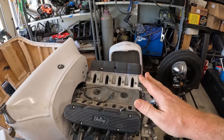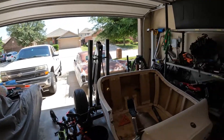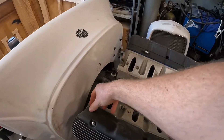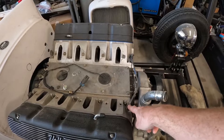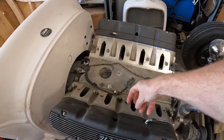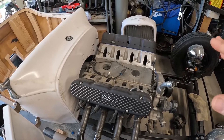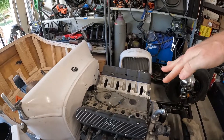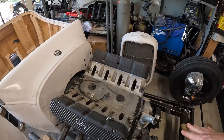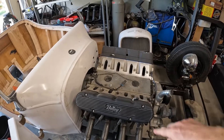Let me explain. In my truck there, from the factory, the front of the engine is higher than the rear of the engine. That allows any steam to flow up and out of these steam ports. If the engine's the other way, obviously that air pocket's going to make its way to the back of the heads and not have any way to escape. So what it boils down to is the angle of your engine. If the front end is high enough, you can get away with just two in the front. But if it's level, I would still run a four port. Or if it's nose down for whatever reason, you need a four port.